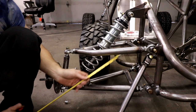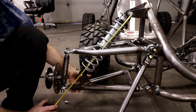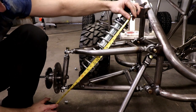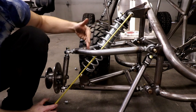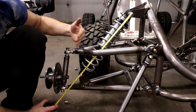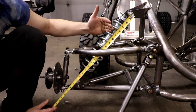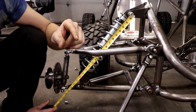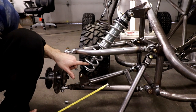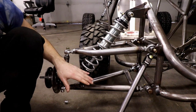What you want to do is find your upper and lower mounting points, then drop your lower a-arm all the way down to full droop and measure that length - for me that's about 16.5 inches with this 16.5-inch shock. Then lift it all the way up to your highest point of travel, put some blocks under there, and measure again. I had 8 inches of measured travel but only 7 inches of actual suspension travel, leaving about 5/8-inch of extra stroke in the shock.